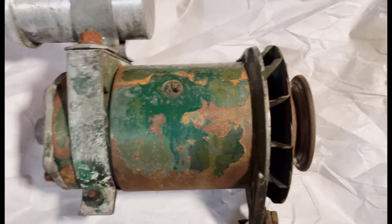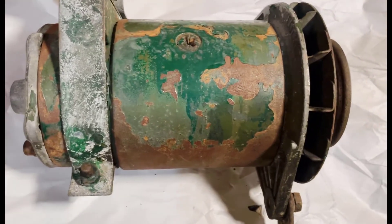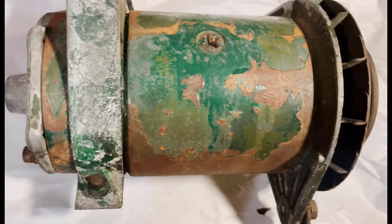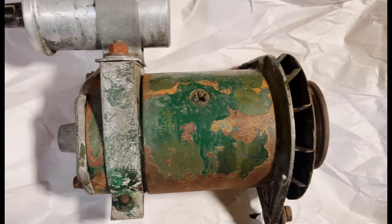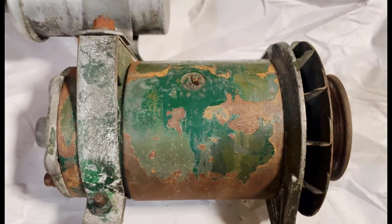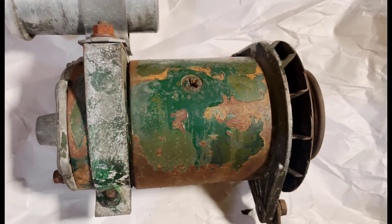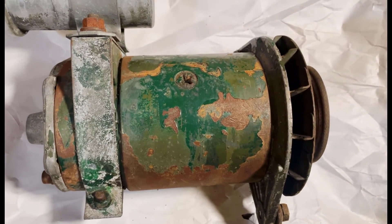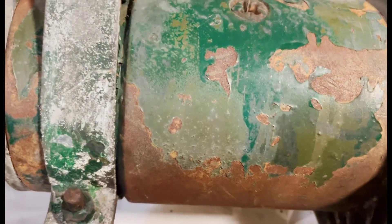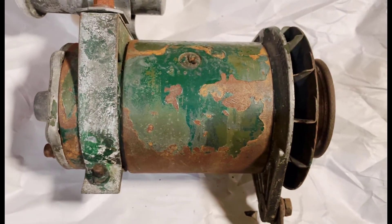The other thing that's really interesting is it has a genuine Lucas coil on the top, but there's a sort of a hip in the generator that fits the bracket for the coil. Typically these generators are just smooth-sided all the way down. So this is somewhat unusual, and suggests that this was original to the car — the casing for the generator has a kind of a hip to it, which is not typical on a lot of these generators.